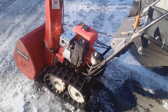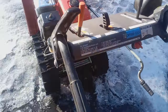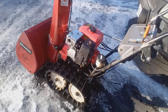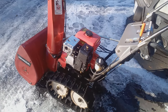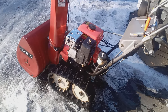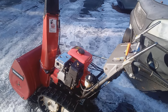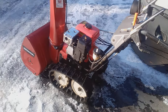That only took 30 seconds to a minute — just pull out the pin, put the pin in the lower hole, and stick it back together. The cable adjustment takes a little bit of trial and error, but I hope you understand what I was trying to do there: balance the speed front and reverse with the cable adjustment. And then if you have good forward speed but you're crawling in reverse, just lower that pin to the bottom hole and you're set to go. Thank you for watching folks, I really appreciate it. If you think this video helped you, please like and subscribe. I really appreciate everybody that's been subscribing to the channel, and we'll see you next time.